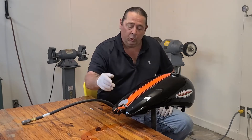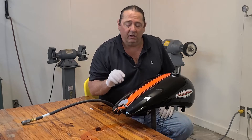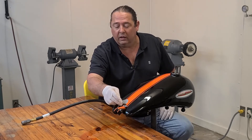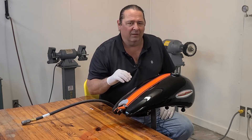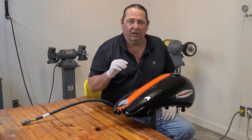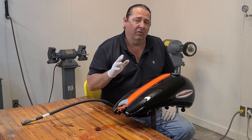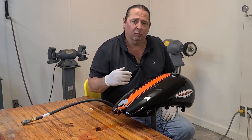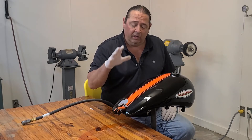There are some options here: you can weld the tank up or you could use a sealer. On this particular one I'm going to use a sealer. The reason is because of where the leak is — it's in a place that's very thin and I'm not so sure about my welding technique there. I'm a pretty good welder but I've got too much invested in this tank. I'm going to go ahead and go with the sealer. The sealer I'll be using is a Caswell product — I've never used it before, it's a two-part epoxy, and I hear a lot of really good things about it.